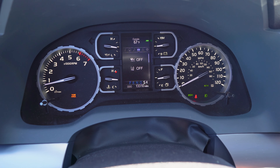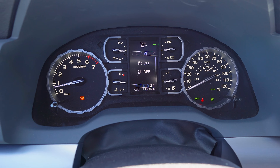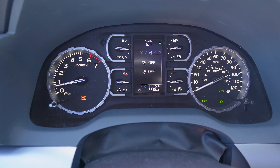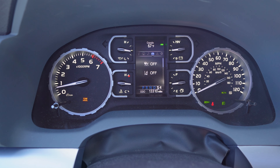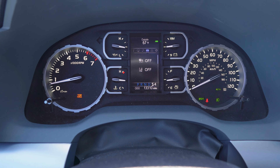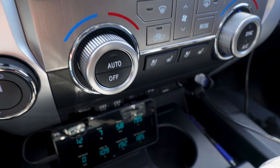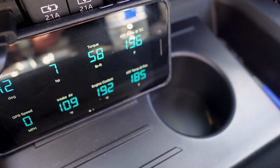You really want to put it over into sequential. Once you're in sequential, you can see here on the gauge cluster — it's S4, which is the default for the Tundra and what the manual automatically puts it in. With this type of trailer, I'll leave it in S4 around town, and then when I'm on the highway, I'll bump it up to S5. If I'm going down a hill and want even more engine braking, I'll manually shift it down to S3. The key being: make sure you're in tow haul, make sure you're manually selecting your gears, and you're not overdoing it on the brakes. As much as you can stay off the brakes, the better the towing experience overall.